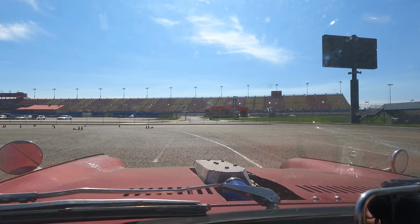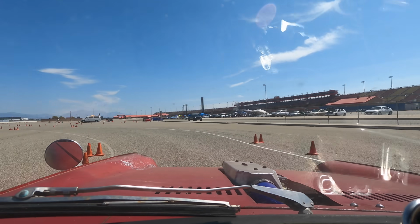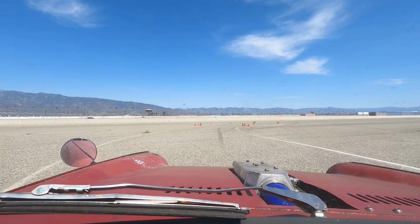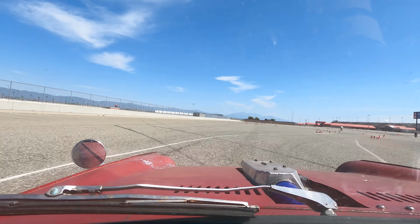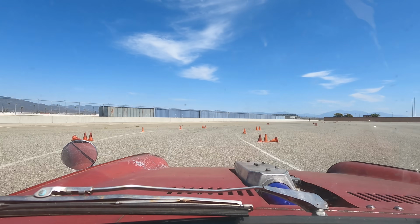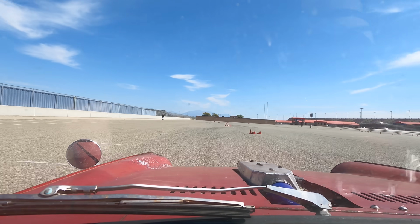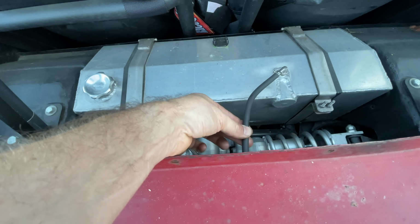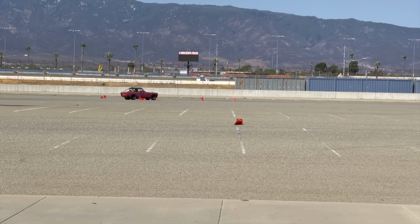This helped a lot. The car got a lot more grip in the rear, so much so that it began hopping around. I'm running really stiff suspension, especially in the rear, and I'm using shocks from a motorcycle, which typically see a lot more movement, so I'm almost certainly oversprung and underdamped, so I'll need to change that. I also had a bit of gas coming out of my fuel tank vent, so add that to the list. But the car was faster, getting my times into the high 36 seconds.